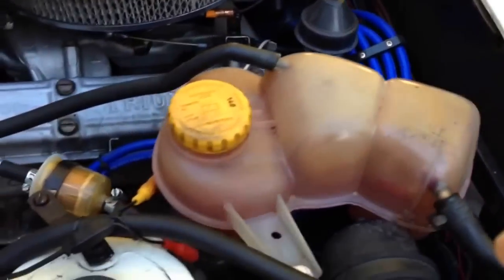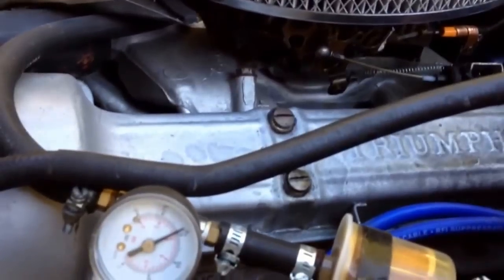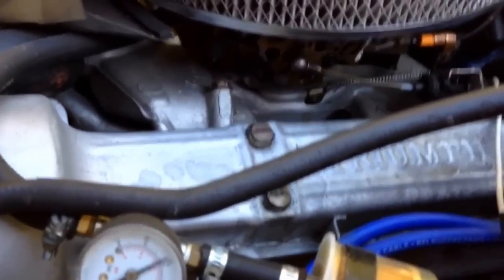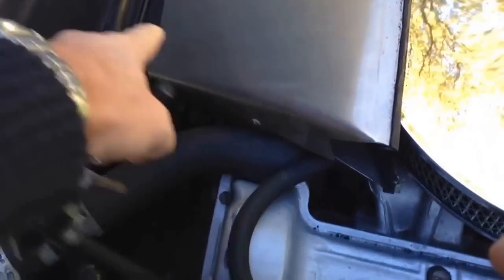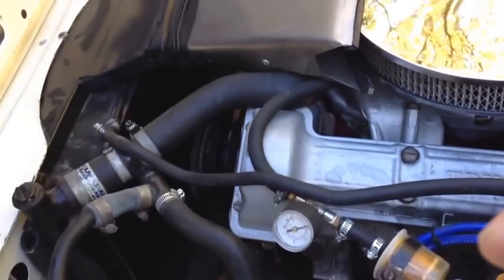With this engine I fitted the Holley 4-barrel carburetor, which you can just see under there. It has a 7-degree adapter plate which keeps the carburetor nice and level — also a good idea. There's a pancake air filter with a cold air feed from the original cold air connection, using a homemade piece of stainless steel that actually came from a kitchen extractor hood.